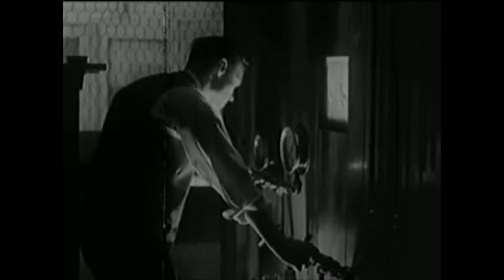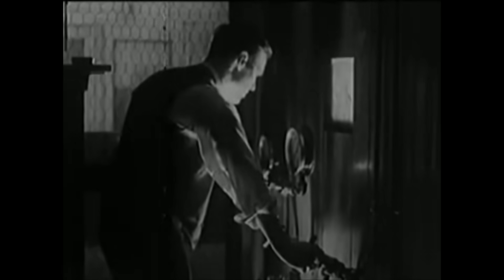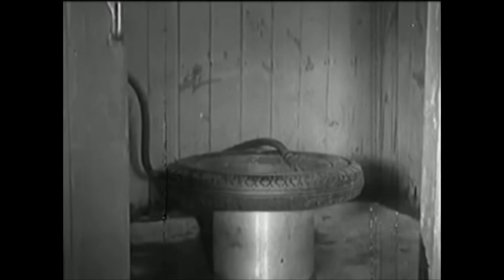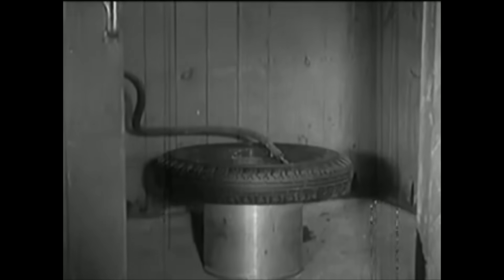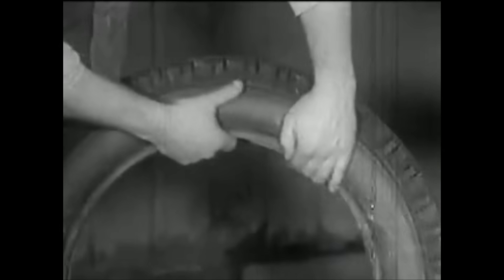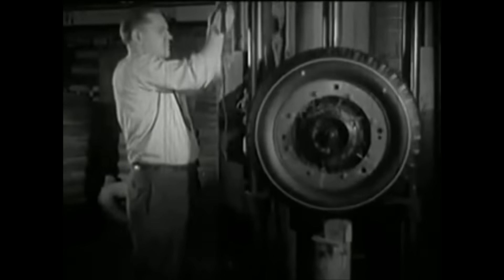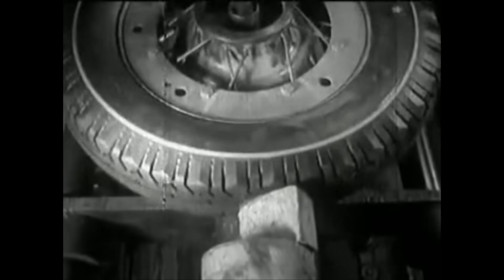There's a section of the laboratory known as the torture chamber — aptly named, because a tire that will run this gauntlet of tire-destructing mechanisms and survive truly earns its right to be called one of the finest tires ever built. Here, a Brunswick Super Service is inflated to four, five, six times its regular inflation point; pressure is forced into it until it bursts. The men conducting these tests are protected by heavily insulated partitions. Water is forced into the tube pound by pound under pressure, inflating the tire to 200 pounds or more until something must give. Under this terrific pressure, the steel bead snapped, but the tire itself did not blow out. Another device tests possible injury from hitting curbs or road obstructions: a tire is mounted on a heavily weighted steel rim and dropped on an iron cleat, repeated many times at many degrees of under-inflation, in an effort to penetrate the protecting wall of the double shock absorbing unit.